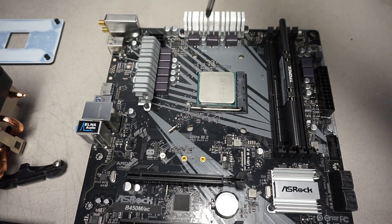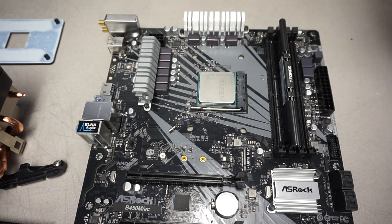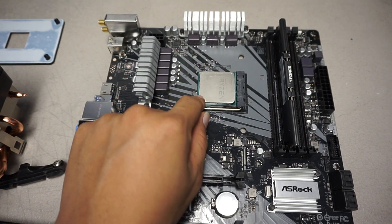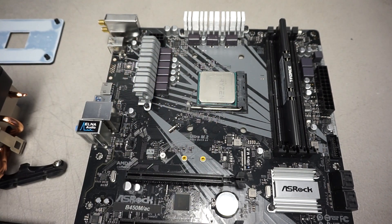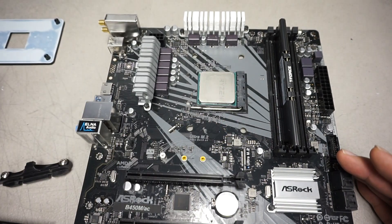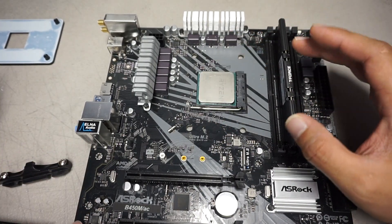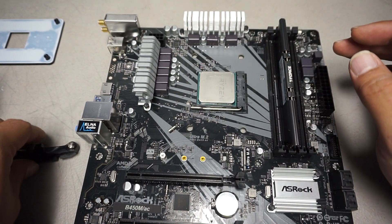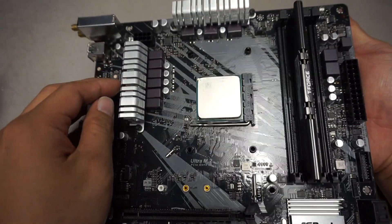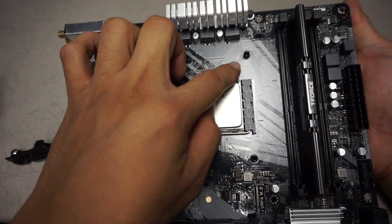If you still have your old cooler on it, simply take the four screws out. They're usually going to be the smaller Cooler Master or Thermaltake ones. In the event that your system is using a more powerful processor that runs hot — for example, this is the 2700X — we're going to need to change to a beefier cooler. Once you get the old heat sink out, you should be left with the back plate situated here, and you can see the standoffs right here.